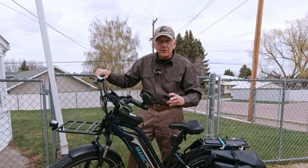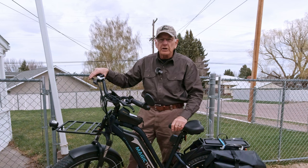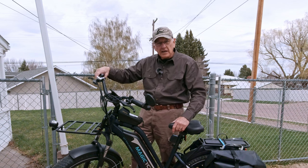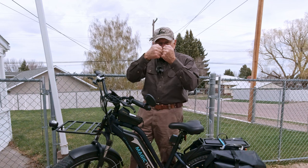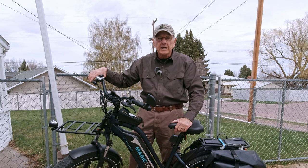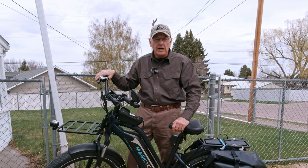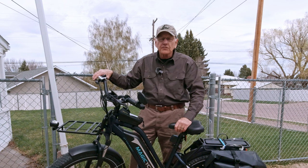The third thing that'll destroy a motor — I discovered this firsthand. I didn't destroy a motor, but I heard an odd noise and knew what it was. I was loaded down with camping gear on the back, got into a rut, used the throttle to get going, and heard those gears slip on each other. I stopped and thought, that's not good. If you're in the wilds with one of these, get it out of the rut first before you come in with throttle. Just be careful with the hub motor and it'll last for years.